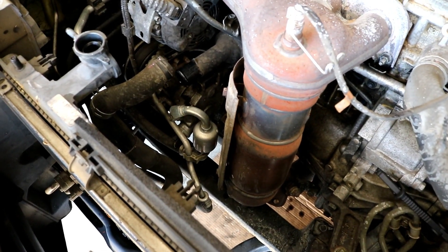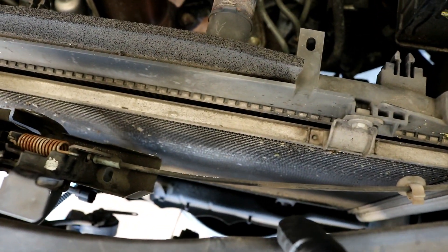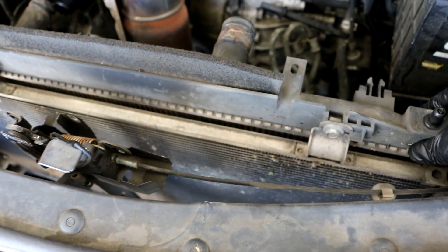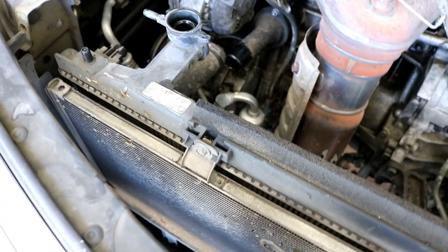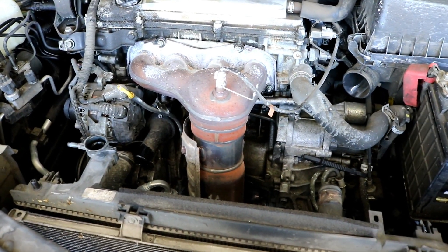There are four condenser bolts — two on top that are easy to access, and two on the bottom. If you need to use a socket instead of a wrench, you can lift the radiator slightly to get access to the bottom bolts. Be careful not to damage the hard AC lines — don't crack or bend them, otherwise you'll lose all your Freon. Remove all four screws, then push the radiator slightly toward the engine and lift it straight up off its rubber mounting tabs on the bottom. Keep it tilted with all ports facing upright so transmission fluid doesn't spill everywhere.